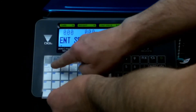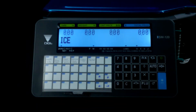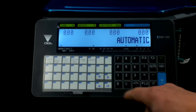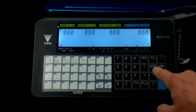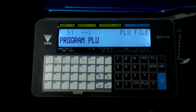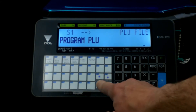We'll put this card in because you're going to write down on here what the item is. We just made a PLU of 802 and we want this to be the button for it — that's the sandwich button. We'll start by hitting our program button once, twice, three times. Now we're at program PLU.